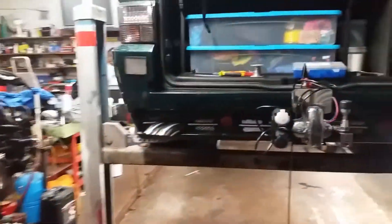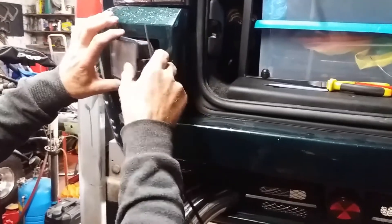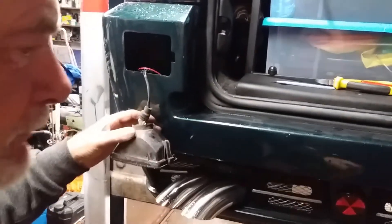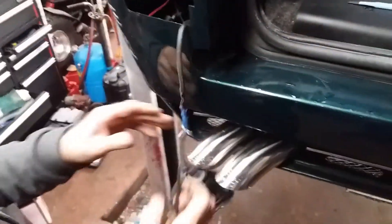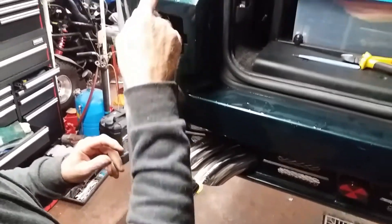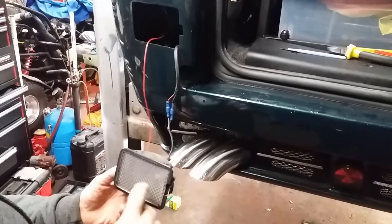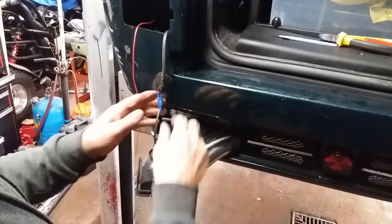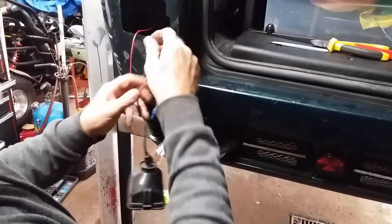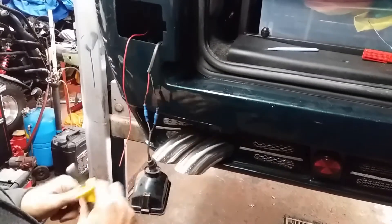Ready when you are Pete. First thing we've got to do is remove the rear fog light — simple to do. Well this one's already been pre-wired, so what we need to do is remove this one. You also need an extra live feed because these new fog lights all have a side light as well.